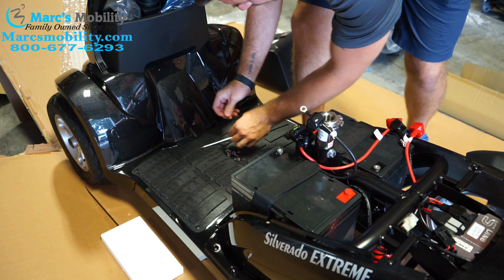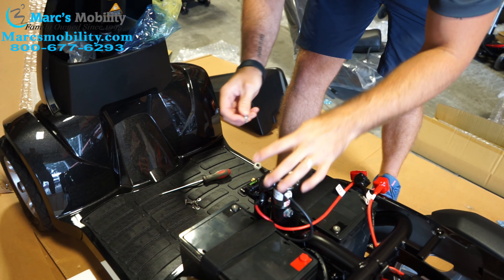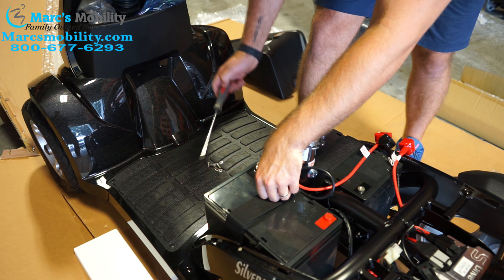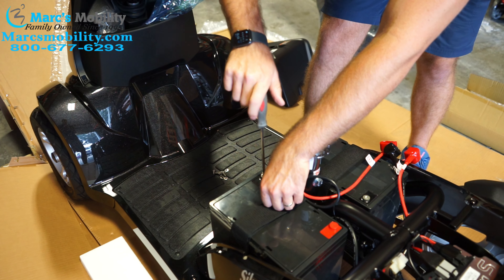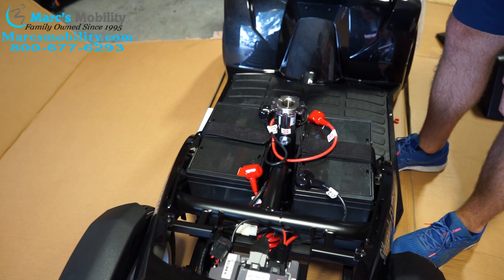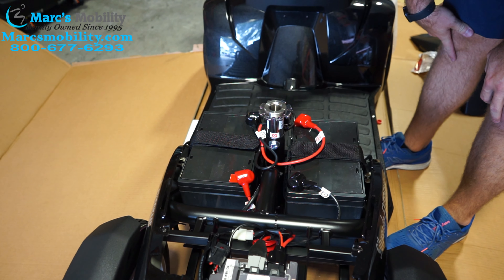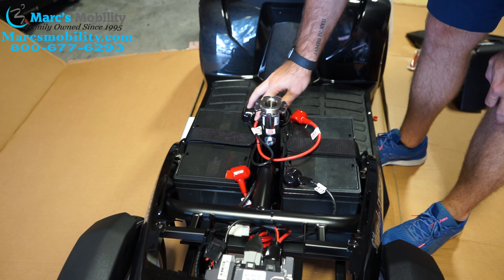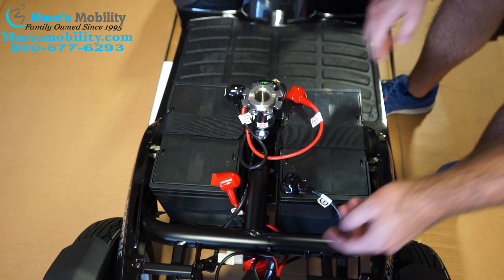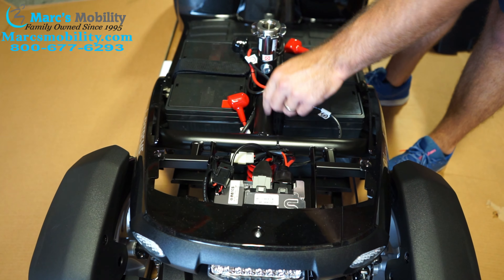What you're going to do is take your screw, put your lock nut on there, then your washer, and run it through into the top. You can use a Phillips screwdriver or a 10-millimeter wrench. You want both your terminals to be closest to the seat post — if not, flip the batteries. With a relay fuse and two wires, they're going to run to opposite batteries: red to red, black to the opposite battery, and two other cables run directly back to your brain box, sending 24 volts into the system.